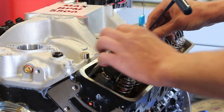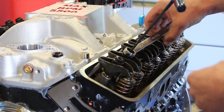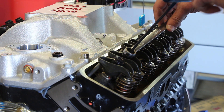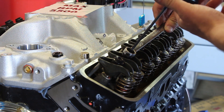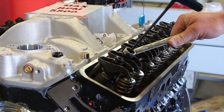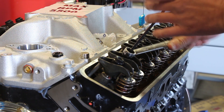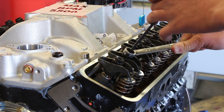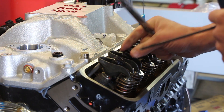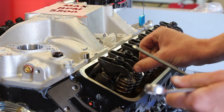Let that wrench rest against the nut as it falls down — the tension's out of the push rod so we can lock the center nut on the inside and put about a sixteenth, maybe an eighth of a turn on these. You can set your street stuff tighter, like a half to a quarter turn, but for the race stuff it seems like it runs better just off zero. So that's pulled tight, it's locked in with the set screw. Feel this push rod — it's tight, the rocker's tight.